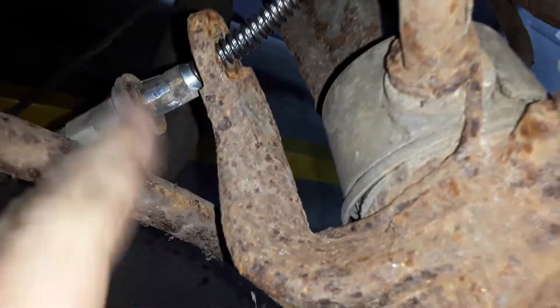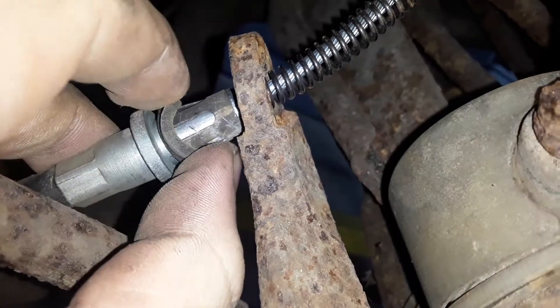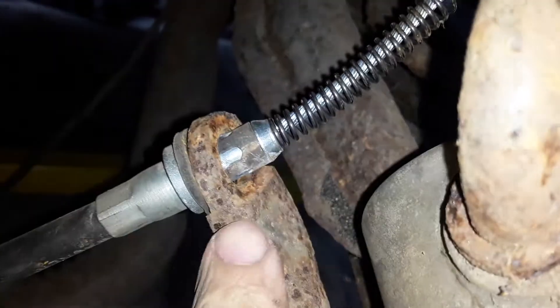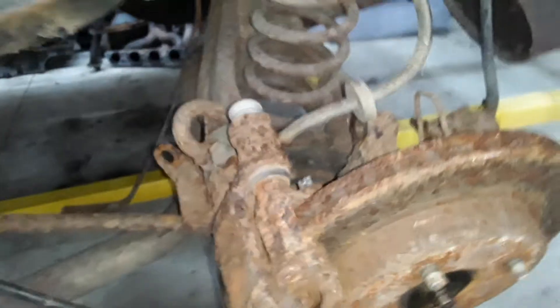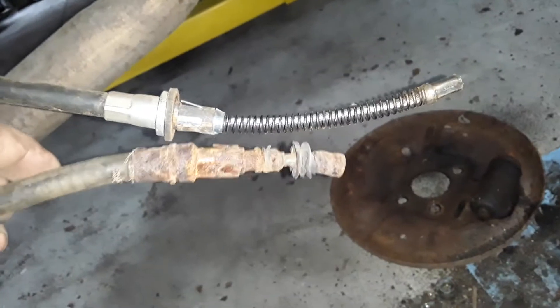To do this, you just have to spread apart these little fins, which you have to do from the get-go anyway. And if you have this little rubber spacer here, you'll have to get rid of it — you can see this rubber spacer takes up too much space because on here it's a fairly thick casting. So with that spacer gone, this will click right in, and that metal clip collar will actually hold it in there snug, like it did from the factory. I actually have a chunk of the Contour handbrake cable, and you can see it's relatively the same thing.